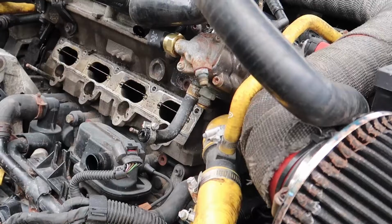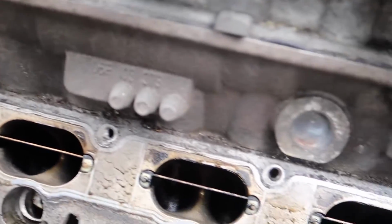And just like that. Alright guys, we just got the intake manifold off. We didn't break not one thing. Congrats. So now if you guys take a look, it's so gunky in there already, so gunky. And we not too long ago put this motor together. This carbon thing is really nasty, and it's really common on GDI cars.